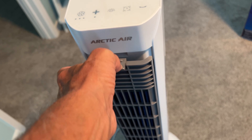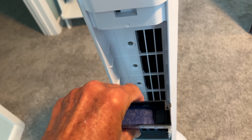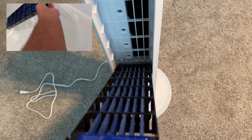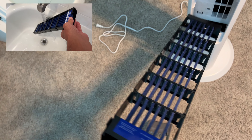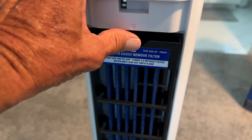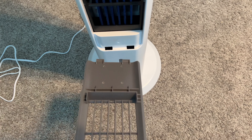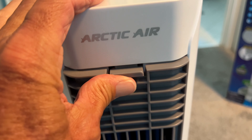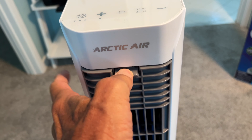This is the way you open it up to get to that filter inside. You've got to wet this — you just get it all wet and then put it back in there. Let me show you how to pull it out — just like that. Then you set it right back in there and it just kind of snaps in. Make sure you have this side facing — it has these little doohickeys at the bottom that you've got to get into those holes. Then up here there's a little connector that you smack in. To get it out again, you just depress it and pull it. Pretty simple.